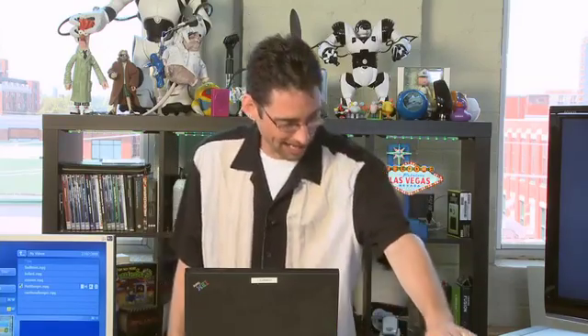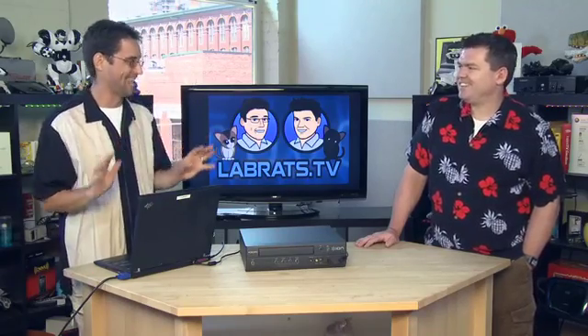Let's talk briefly about the quality. Back in the day we're talking about 480i technology — about 240 lines of interlaced content — so really very low resolution. It's not the resolution you'd expect from a DVD player; it's going to look like an old episode of I Love Lucy. Maximum 640 across by 480 down when it's all put together. There's also a tracking button on here — this is a problem with old VCRs. You may notice in the clip there's a line running along the bottom. That's a tracking issue because of the way the heads spin inside and lay things down on the tape. Things don't line up 100% and you get a little staticky line moving up and down the picture.